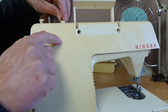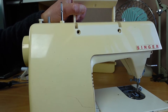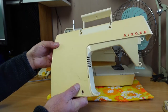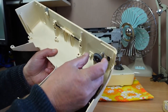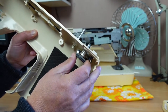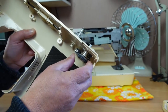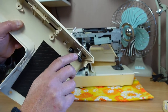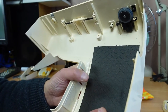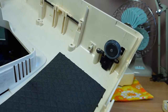Sometimes the spool pin will dip down and catch on the workings inside, so it's probably best to have that pulled up. There's the back cover — needs a good clean. There's the bobbin winder. I recall from the first video that when I tried it out it was slipping a fair bit; I think it needs a good oil. You do have to be careful when oiling these not to over-oil them, because you don't want the oil dropping down onto the bobbin winder rubber. That almost looks like some sort of sound dampening on the back of the inside cover.